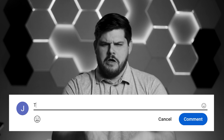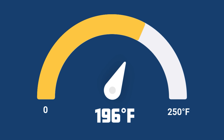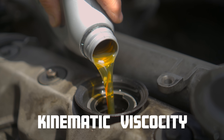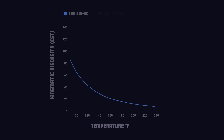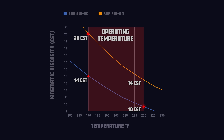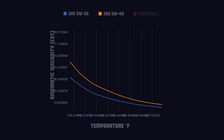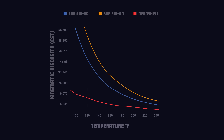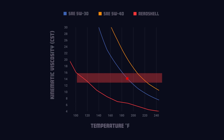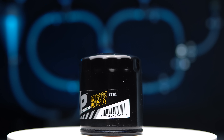Now, before you go to the comments saying that is nowhere near operating temperatures — you would be correct. Normal operating temperatures range anywhere from 190 to 220 degrees Fahrenheit. But like the ISO standard, we're trying to emulate the kinematic viscosity of motor oil at operating temperatures. This is a graph of 5W30 and 5W40 motor oil's kinematic viscosity across a range of temperatures. You can see kinematic viscosity anywhere between 14 to 10 centistokes and 20 to 14 centistokes respectively at operating temperatures. The AeroShell 41 fluid at around 104 degrees Fahrenheit has a spec between 13.2 and 15.68 centistokes, thus simulating 5W30 at around 190 degrees Fahrenheit and 5W40 at around 220 degrees Fahrenheit.